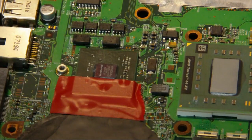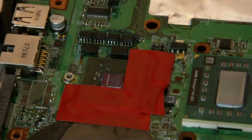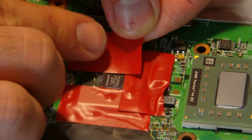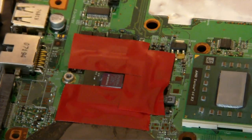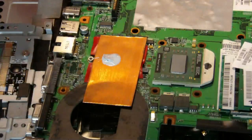What I'm doing right now is putting some thick electrical tape, just to make sure when I put the copper over top it doesn't short out, because it's a very big piece of copper. Don't skimp on the copper — that's going to drop the temperature of that GPU. The more the better. Just make sure that you safeguard against short-outs, because copper is very conductive and could definitely lead to some issues for you.